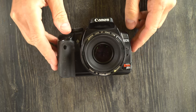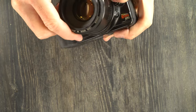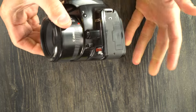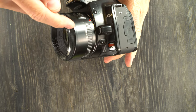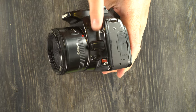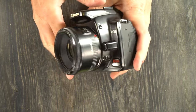This is an interchangeable lens digital SLR. The lenses can be taken off and a different one put back on at any time when you're not taking a photo without messing it up. DSLR means it's a digital camera, not film. Single lens reflex means that the light comes through the lens, hits a mirror inside of the camera, bounces up through more mirrors and out the viewfinder.